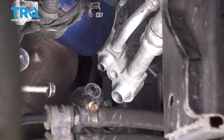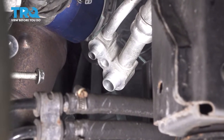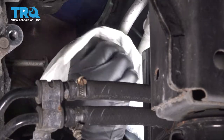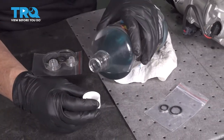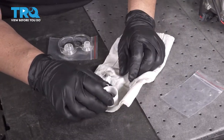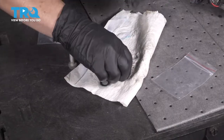Those old seals are probably going to leak real soon. Now I'm looking at the line — make sure it's not corroded, no marks, and everything will seat properly. I'll take a clean rag and wipe this down to make sure there's no debris left behind, no burrs, because that aluminum can get nicked — if it does, it'll break the seal and we'll have problems. Before installing the new seals, I like to add a little bit of fresh PAG oil to the cap, drop those seals right in to get them soaked with fresh PAG oil, then install them right in the line.